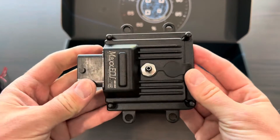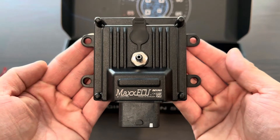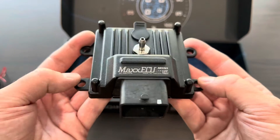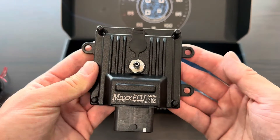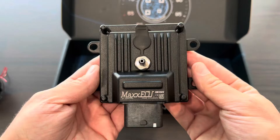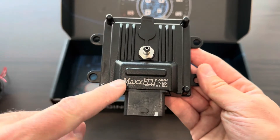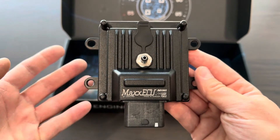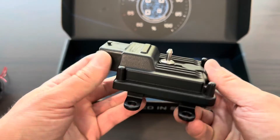Even though this is a small ECU with a limited number of pins, it can be expanded through the CAN bus with just two wires — you can almost do an infinite amount with these ECUs. That's one of the best things about this compared to Microsquirt, which you've seen a ton of on my channel, and some other products out there. They're just limited in software, whereas Max ECU essentially has very similar software across all of their different ECUs. So if you can do a specific math channel with a 4D table on one of their higher-end ECUs, you can do the same thing on the most basic ECU.